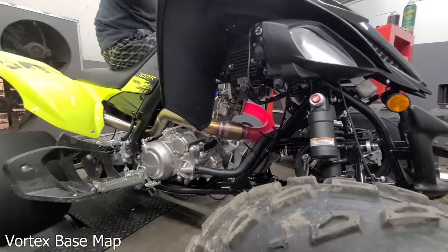Oh yeah, it's not quite up to temp, and I don't have the AIS deleted off, so I hear a little bit of popping. When we did the dynoing yesterday, we had the AIS clamped, so if I delete it, it'll clear that popping up. The R5 sounds really good now. I was worried about it when I first put it on. It didn't sound that great, but the tuning is what made it sound poor. Now it sounds good. It's barking.